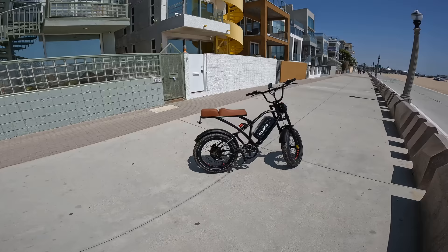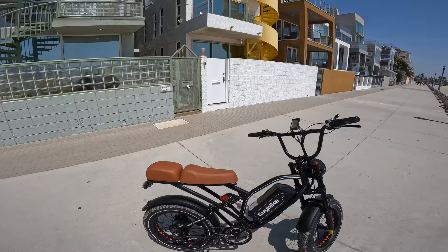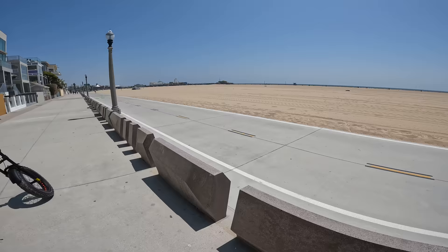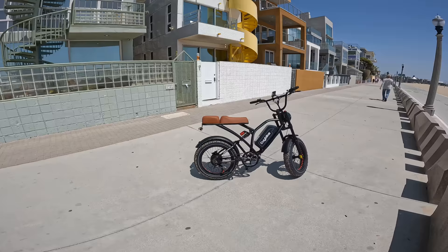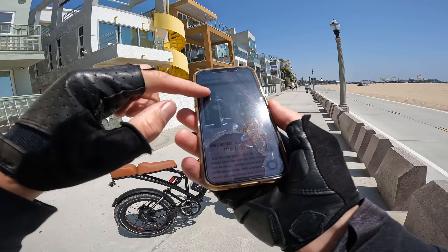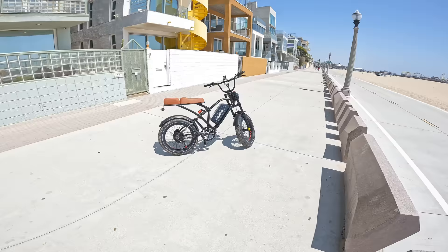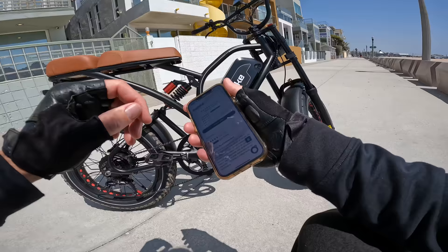Final thoughts on the EYU Bike S4. The final range isn't going to be good but it's nothing to do with the battery - it's how I'm riding it. It has this massive 25 amp hour battery pack, and yes you can get excellent range, but personally I find I end up riding a lot faster when I know it has so much energy. It's 1200 watt hours, which is much larger than we normally see. The company website does give you a realistic range - 75 miles if you go slow, or about 44 miles if you're going fast utilizing all that power.